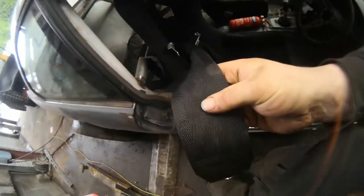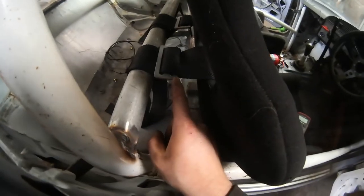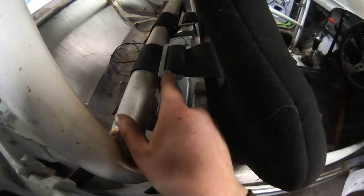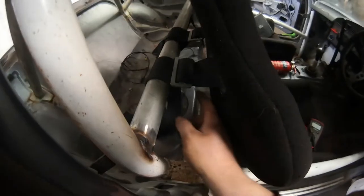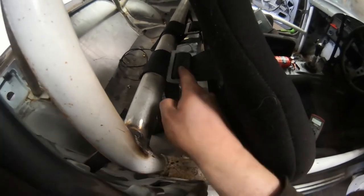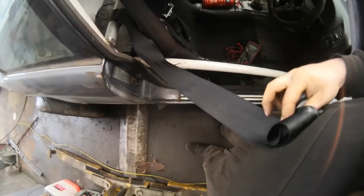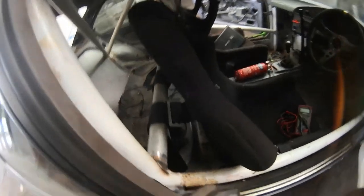Just a final thing to note about harness wrapping. The belt goes through the seat — under this buckle, over this buckle, under this buckle, under the bar, over the top, under this buckle, over this buckle, under this buckle — the same but going backwards — and that brings the tail through the hole. Then you go back over the first buckle, over the second buckle, and under the third buckle. That ensures it won't pull through. Roll it up and cable tie it somewhere neat. I see a lot of people wrap them wrong — wrap them right, don't die, look after yourselves.